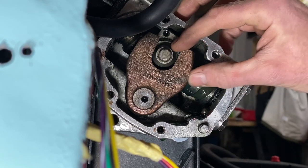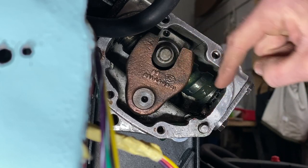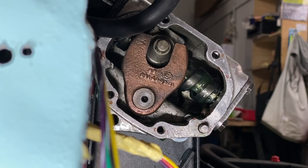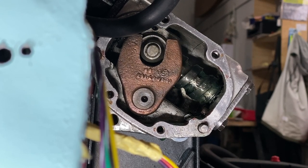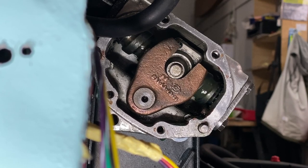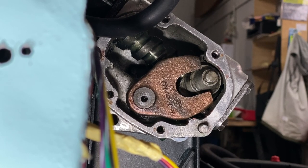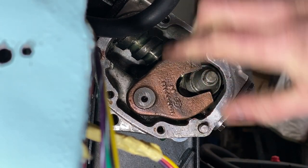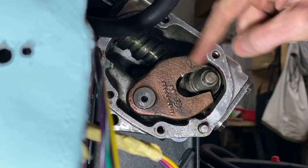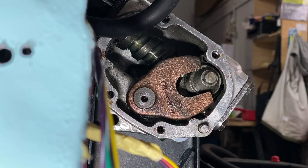So you can see the main pivot point here, it's kind of like a spanner head as it rotates from this point up and down the shaft as this screw gear moves or twists around left and right. So if I twist the shaft, you'll see it moving up and down, and that's the limitation of the steering assembly, is that once I reach the end here, that's it. And obviously this is held in place on the face of this panel here is a little bearing race, and the bearing slides up and down, and so it stops it from twisting up this way. But basically you have that much movement and that's it.